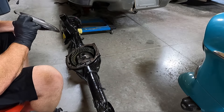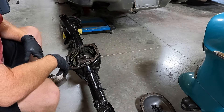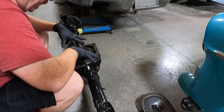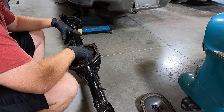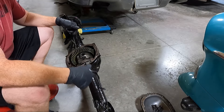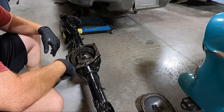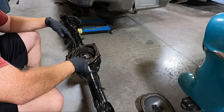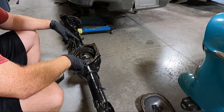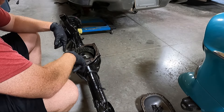One thing about gear oil — it is about the nastiest smelling thing you'll ever smell in your life. You can see there's some old gasket material here that we need to clean out. I'm trying to keep things away from the gears. One issue he had with this thing was moving the bearings from side to side, and he had some trouble getting the C-clip back in — it seems to be a common issue. Let's go ahead and get some brake clean and clean this up.